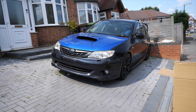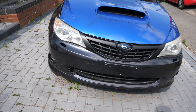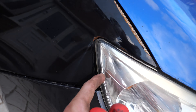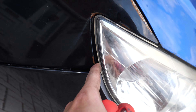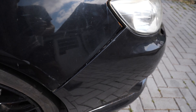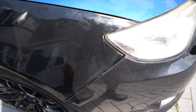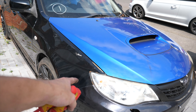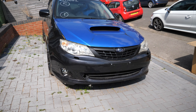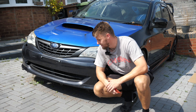Nothing's been welded in yet - this has just been kind of put into place. I think this wing is bent because the headlight sits nice there and then when it comes down here it goes behind the headlight. So the bumper doesn't actually line up properly - I think it was kinked there and it's like pushed down there. I don't know if that can be pulled out a bit, but it doesn't look that bad to be fair. I think it just needs sanding and painting. Guys, it looks really good I think.